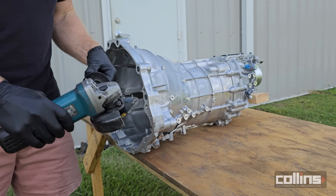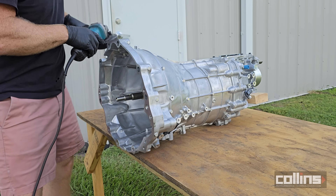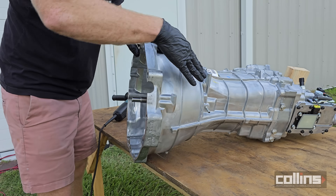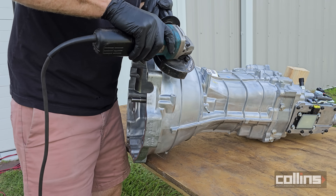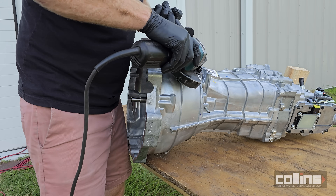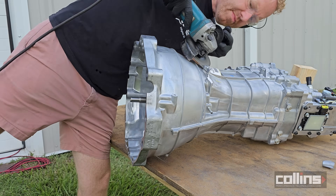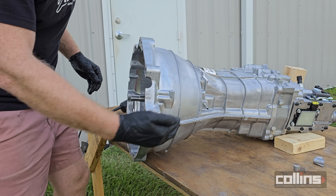We've got a four-and-a-half inch angle grinder and we're going to start cutting the transmission. There's still going to be some residual oil. This little tab right here we're going to cut first — it basically hits the transmission tunnel area inside most swap vehicles unless it's an actual Z or G35. Removing it will make it a lot easier to then cut the circumferential band.